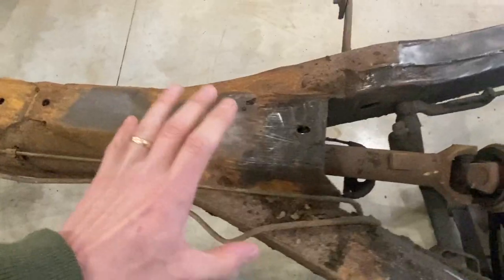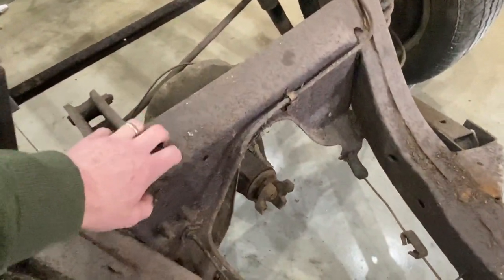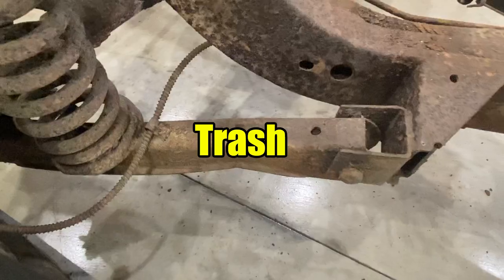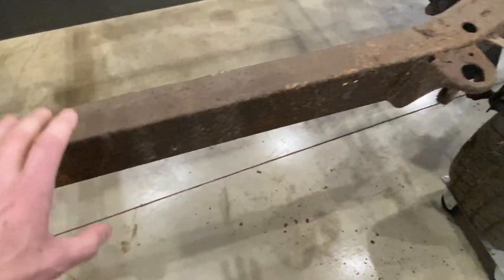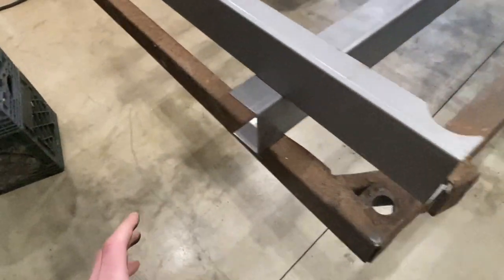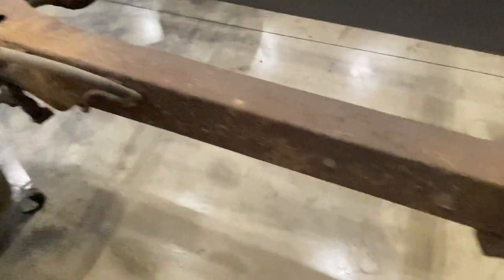And this is where it starts getting pretty rough. If you're afraid of rust, this is the point where you want to close your eyes. You can see the rust is getting a little thicker. This crossmember has some pretty decent pitting on it. Looking at the trailing arm, you can see it's bent — looks like it slid into something. So this trailing arm is trash. This mount's still solid but obviously really pitted and gross. This whole rear section is pretty thin, and you can actually wiggle the whole rear frame up and down because the metal is really thin. It's rotted out and buckled — just in terrible condition.